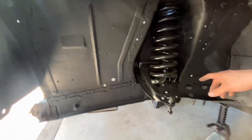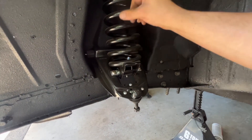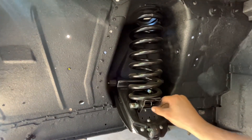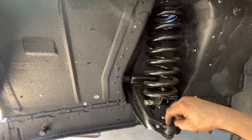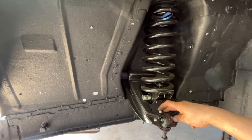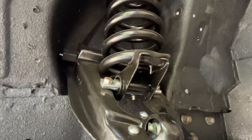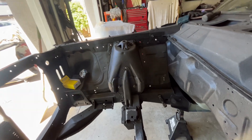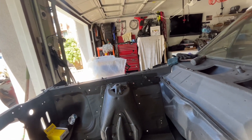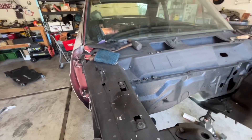The hardest part was figuring out the template, welding it in, and making sure I got all the cracks taken care of. This is a Scott Drake one-inch drop spring and Scott Drake spring perch, with Dorman upper and lower control arms. I like that it has the zerk fitting, but the only problem is if the ball joint goes bad I have to drill it out because they're studded on — but they're only about $40 so I can just redo them. Once I get it on the ground I can decide on the engine, and I need to get brake lines sorted too.